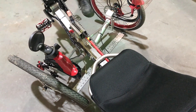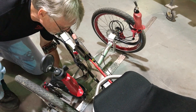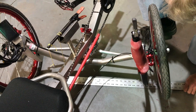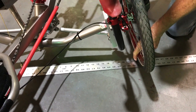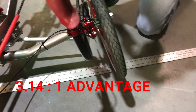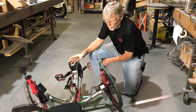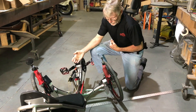So we're going to mark that spot and pull the ruler back. We're going to put a mark right on seven, then pull the ruler back to zero it on that mark. Now we can count up from there and we can see our contact patch over here is 22 inches to the inside of the contact patch on the right wheel. That gives us an idea of the weight transfer happening as you go into a corner — a percentage of how much weight is being transferred to the inner wheel as opposed to the outer wheel.